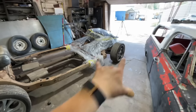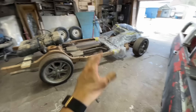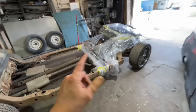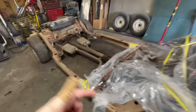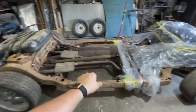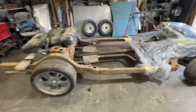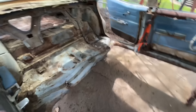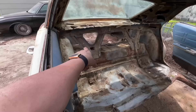The Impala is 119 inches. You can kind of finagle an inch and a half, but you can't finagle four inches. So we went ahead and pulled the chassis in — I'm gonna have to lengthen it. The good news is when there's no body on it, it's pretty easy to lengthen: we're just gonna put some really heavy duty C-channel in there and weld the living hell out of it. We'll have to lengthen the driveshaft, and hopefully brake lines and fuel lines have enough slack. Now that we know exactly what we're using — which is basically nothing of the stock floor — I'm gonna cut it all out right at the package tray reinforcements.